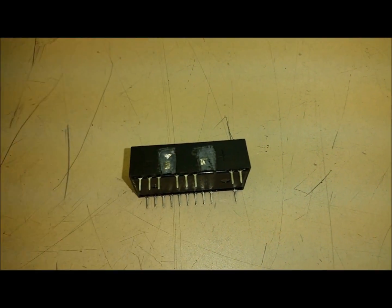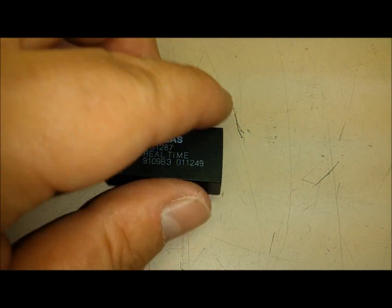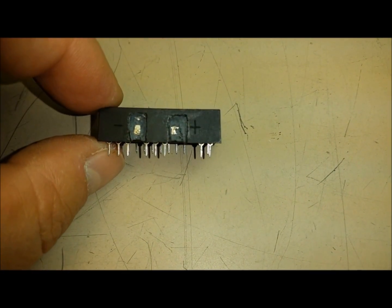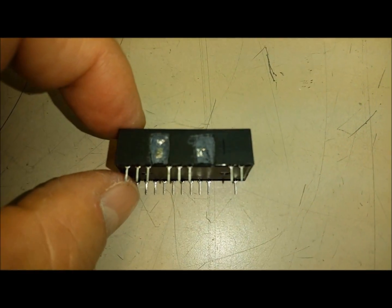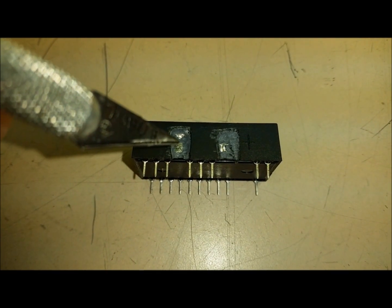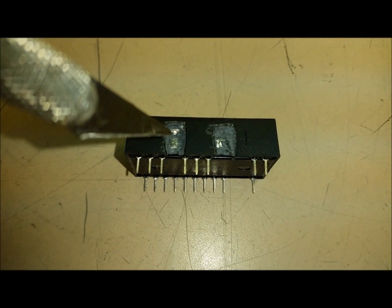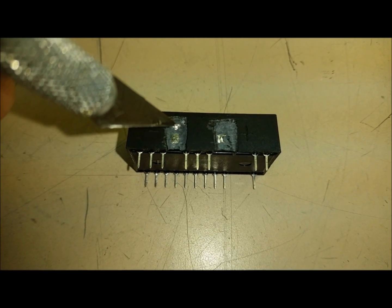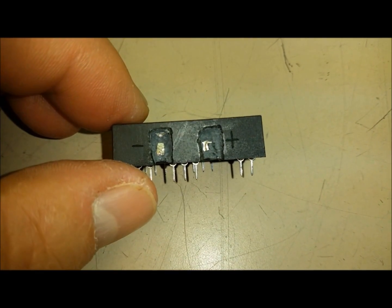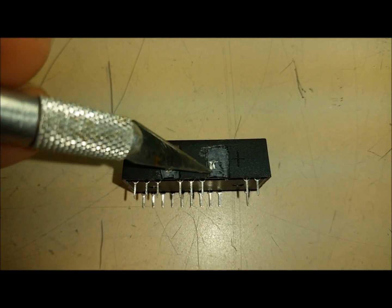Here's our little Dallas chip for our PS2 computer. Did some searching on the web — thanks to those who figured this out. I used the Dremel tool, cut down right up here, and kept going. It's basically a regular DIP pin pushed up along with this one, and this one is held all the way up where they started the battery lead. You have to use the Dremel tool to get down there, then just separate it — this will be the negative side and this will be the positive side.